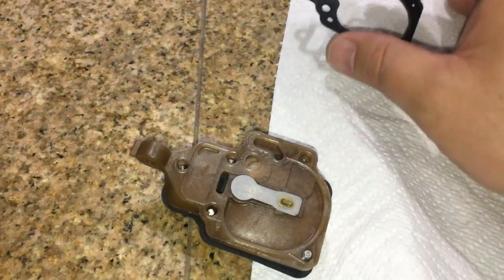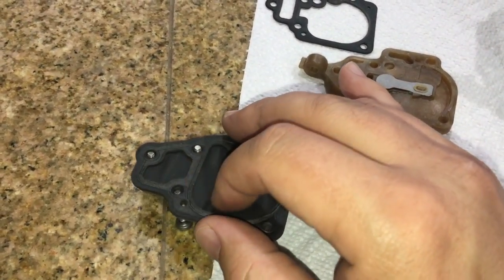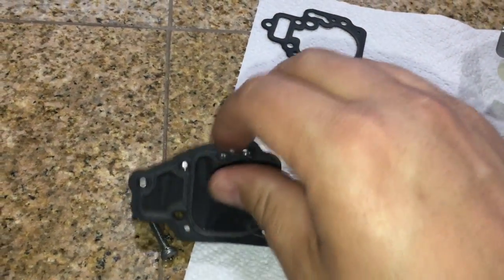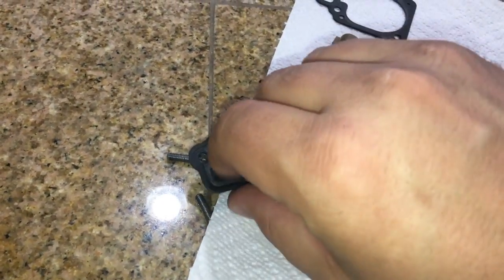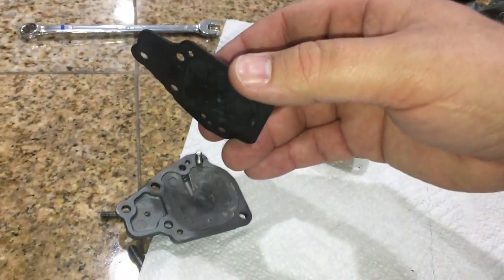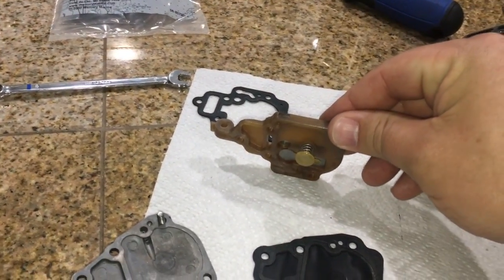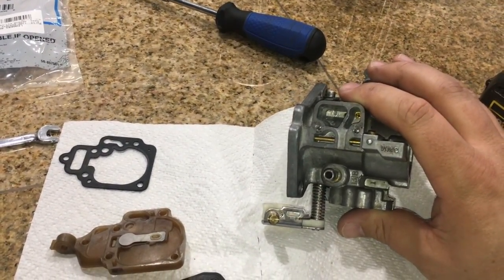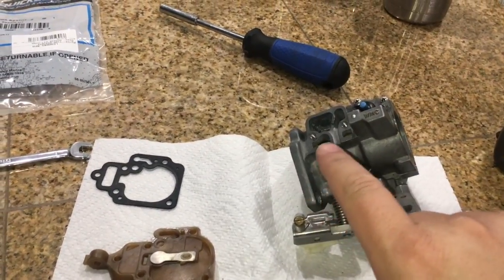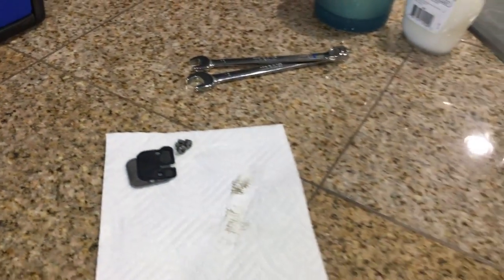Let me show you the different parts. There's a gasket there, then you have that and the diaphragm, and then that separates. There's a little spring on that side — that's where that goes. I've already moved the piece off the top. Some of these have an electronic choke that goes in there where that top bracket was; this one does not.